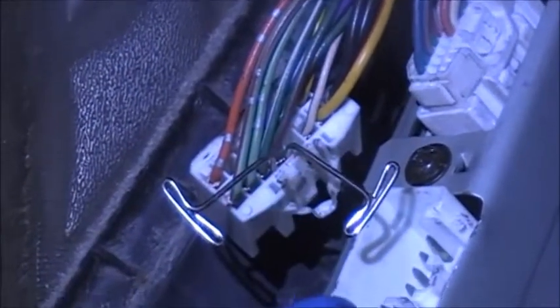I took the connector out and was looking for the ohm reading to see if I could get a proper reading. The spec is 2.7 to 7 ohms - anything in between is good for this solenoid. But I was getting a lot of weird readings from those two pins on the line pressure solenoid.